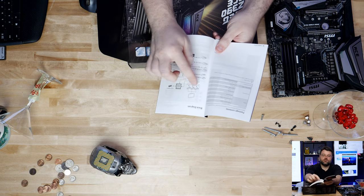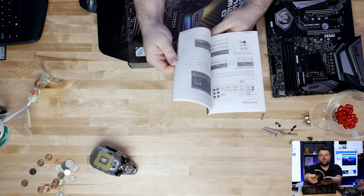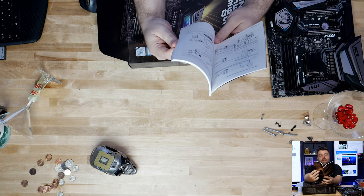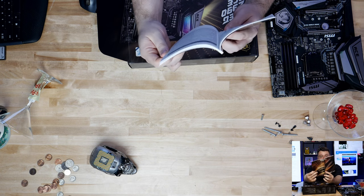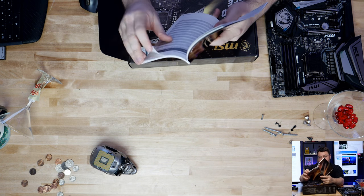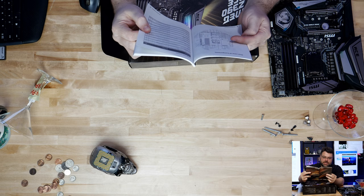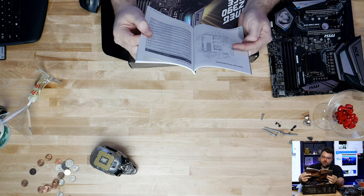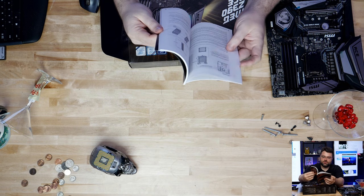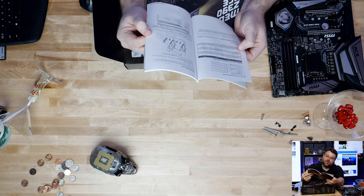Maybe the bottom slot is a switch since it has three, but it would be x8/x4/x4 if that were the case. Although if that were the case, you would have the option of running a PCI Express M.2 add-in card, and then that plus the DMI would not bottleneck. But the bottom slot is usually serviced by the DMI anyway. PCIe 1 through 6 is just a PCIe expansion slot. That's not super useful. The only way to figure this out is to put it on the test bench.